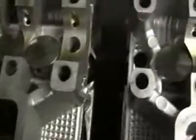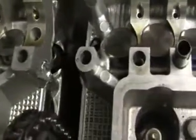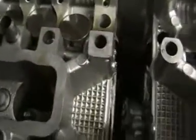I really don't want to take the head off, but I'm going to have to, I think, because there's no way of checking if the valves are bent or not. So what I could do, I suppose, is temporarily put the cam back on, put it back in the head, time it up and just try and turn it over by hand. Anyway, I'll decide what to do in the next video.